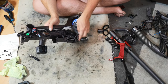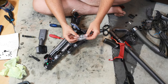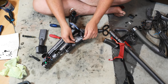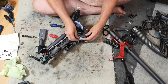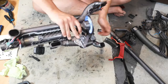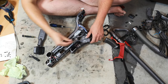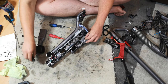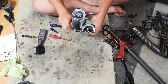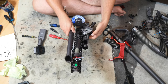Obviously, we're missing a key part that makes everything move, which is this clear plastic wheel. And the way to do this is to slide it onto the rod first. Then, making sure that the peg for the release, for that little hose, is sat inside that groove, take the screw for this part and the screwdriver to fit it, because this is a smaller screw. And there we go. Now it should all move very nicely, which it does.